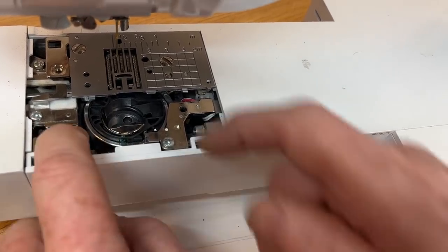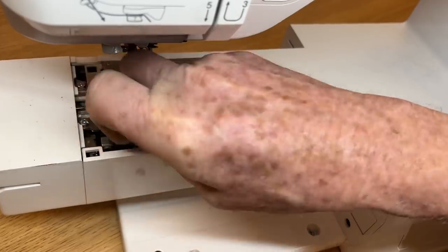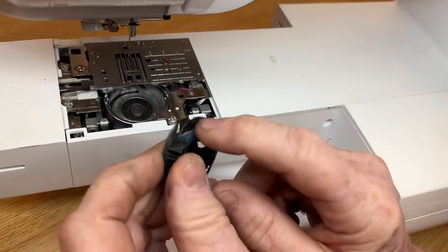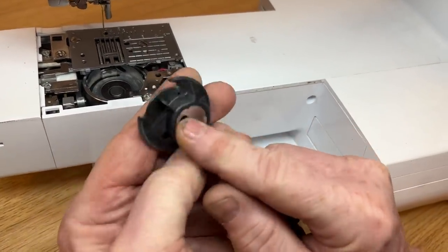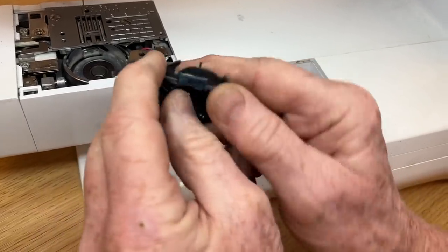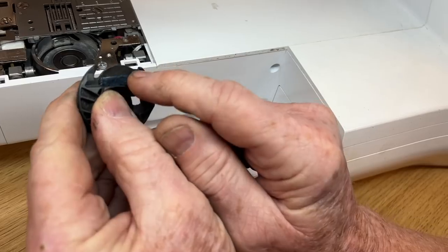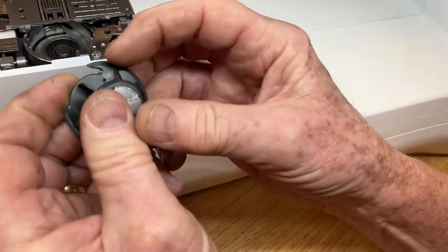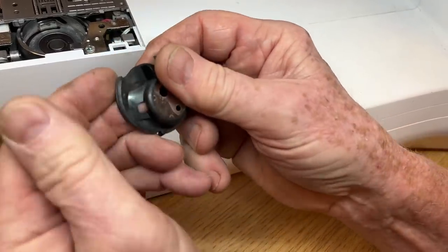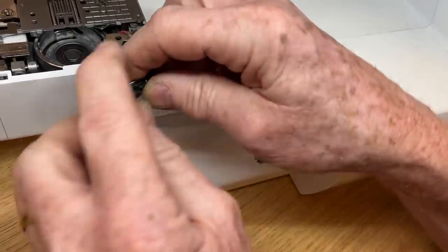What I do see — I'll pull this out — is that it has jumped out of its place because something got jammed. Along this front edge you'll see where the needle has penetrated and made holes. So what I do is take one of those orange emery boards and file it nice and smooth. If it's made marks along the edge, do the same thing — just file it real nice and smooth and then the thread won't snag on it.